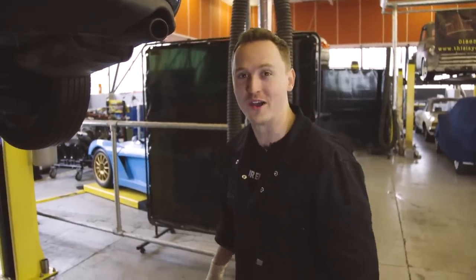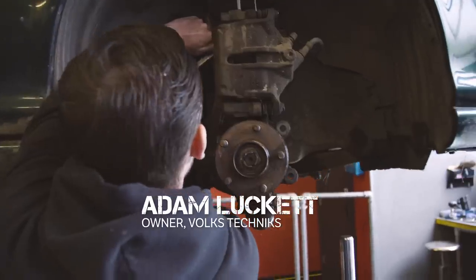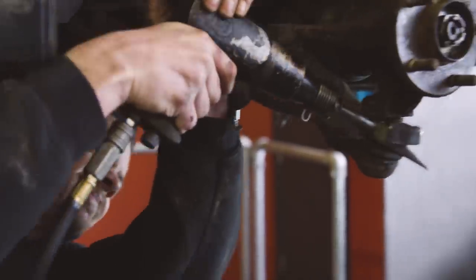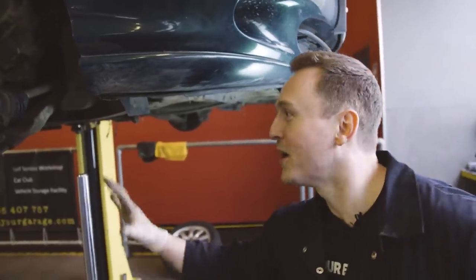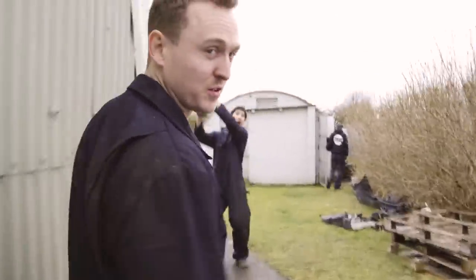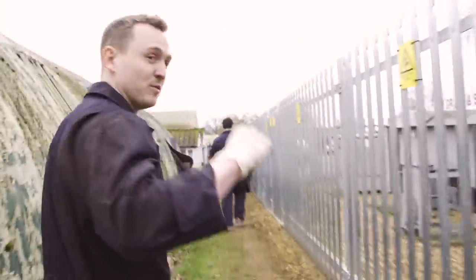Part one of this being an off-roader: complete. Meanwhile at the front, all-round good guy Adam from Volkstechnix had jumped in to remove the hub assembly to later allow for the broken pinch bolt to get drilled out. It's just all hands on board — everyone's seen the X-Type and they're like, I've always wanted to make that an off-roader, I've always wanted to jack it up. We are on our way now to a metal fabricator to get these metal cones made up to weld onto the plate and then raise the suspension.